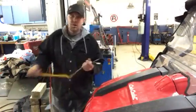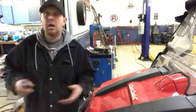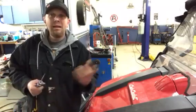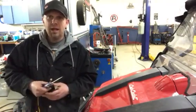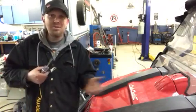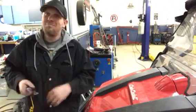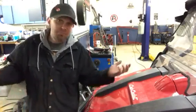Now you can do this to your muscle car or any vehicle — you can even do this to a motorcycle. I've had Harleys come in with the same problem. Ended up finding out the little hydraulic pressure switch for the brake light was shorted out, but not enough to burn the wires, not enough to turn on a taillight, but enough that it was drawing juice and the bike would sit for a week and die.